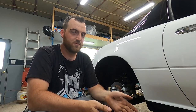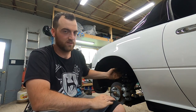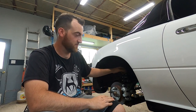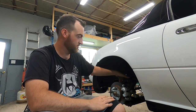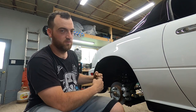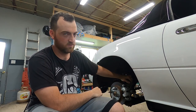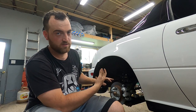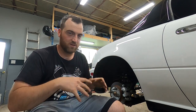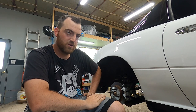There are a couple ways to drop the diff concerning the axles. Mine have been in and out probably 10 times in the last two years, so I know they come out. If you cannot take your axles out, if you just loosen this top nut here on the top of the knuckle, you can pull it out towards you, pop the axle out, and push it to the side of the diff. What I'm going to do is undo the top nut and axle nut, take the whole assembly out — makes it way simpler. You can just drop the diff straight down with no working around it.